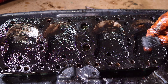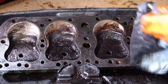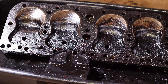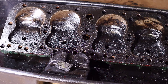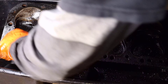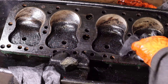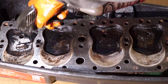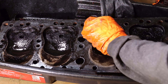As a side note, since this is a gasoline engine we'll briefly overview gasoline as related to these carbon deposits. Gasoline is created from refining crude oil at oil refineries. Chemically, gasoline is made up of many things, especially considering the additives to the fuel. We'll focus on the organic compounds in the gasoline — these are composed of carbon and hydrogen, which is why you may have heard the term hydrocarbons in conversations about the chemistry of gasoline. If burnt in the simplest form with only oxygen, the elements would be hydrogen, carbon and oxygen. With full combustion they would form water (H2O) or carbon dioxide (CO2). If combustion wasn't fully complete, carbon monoxide (CO) would also be formed. It is most likely that you have heard about carbon dioxide and carbon monoxide in conversations about exhaust or emissions of a gasoline engine.